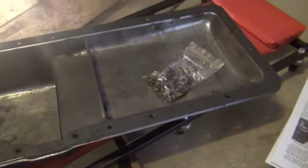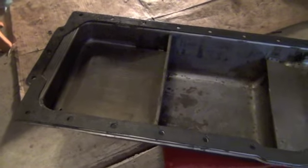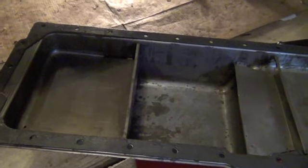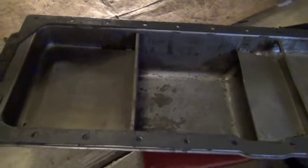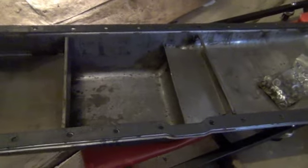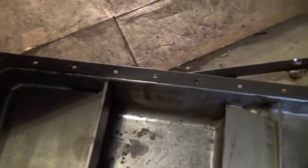Okay, I got the gasket back on, RTV on. You can say just follow the old commercial for Brylcreem: a little dab will do it. I had my glove on, so I could go along and work it in as I moved along, because RTV seems to stick pretty good to skin.